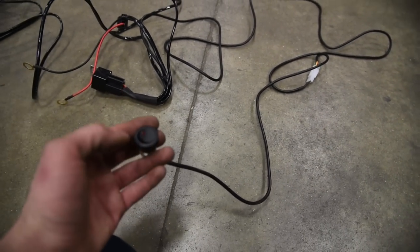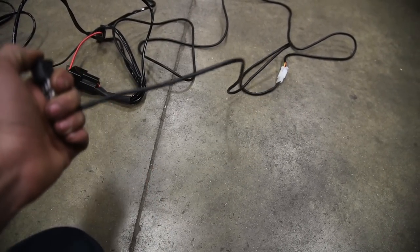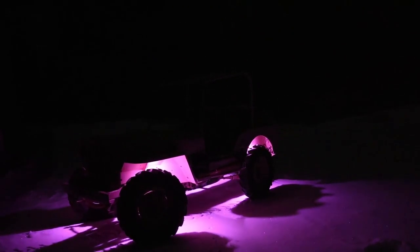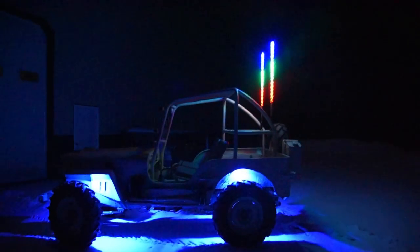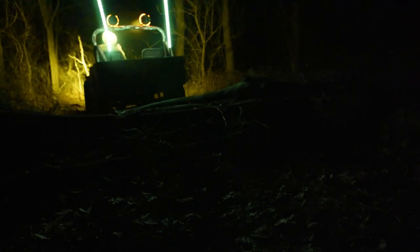When you flip the switch on your dash, all you're doing is telling the relay to connect those two big wires. It takes very little electrical draw to operate a switch — just like the solenoid where you have big lugs on the side and tiny lugs on top. This accessory has a long harness that goes to your dash as the on-off switch to operate that big relay. When working with a relay system, the fuse is before it, between it and the battery. Since this harness is pre-made, the moment you hook it up to a battery, the key switch makes it work on and off — no fuse block connection needed. That's enough wiring talk for today. I hope this was informative enough that someone with no experience could go buy a Jeep, drag it out of the woods, and at least wire it up to run the engine — or be able to diagnose why electrical components aren't working. I really encourage everybody to look up more YouTube videos on advanced wiring: different types of connectors, weather pack connectors, modern split wire looming, cable management, and all those details that take a build to the next level.